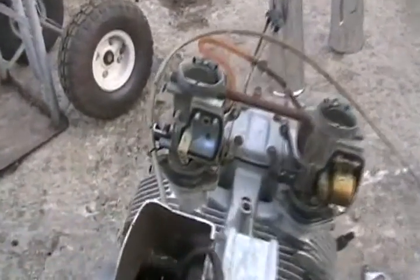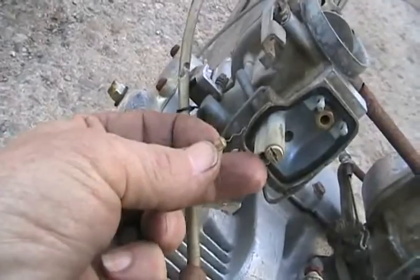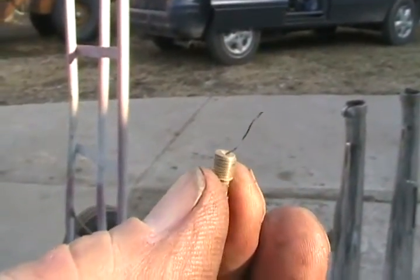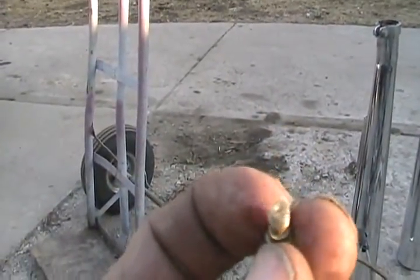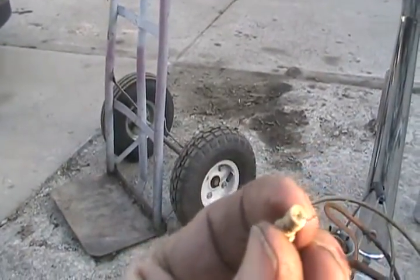There's the carb bowls, so now while it's apart I'm tuning up the carbs. I've already cleaned the main jets, blown out the balls and cleaned them. Now these little bitty tiny jets are the idle jet mixture jets, which go in that hole — you can see the one down there that's still installed. I've got a little piece of wire from my power wire brush — that hole is so tiny but it's good for cleaning it out, because it doesn't seem to want to idle well. Seems to be a bit lean — probably 30 or 40 years of gunge.